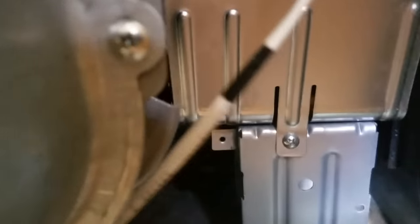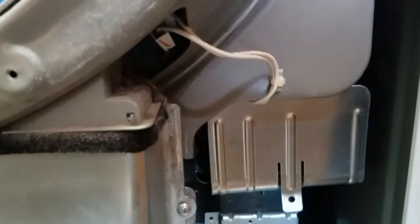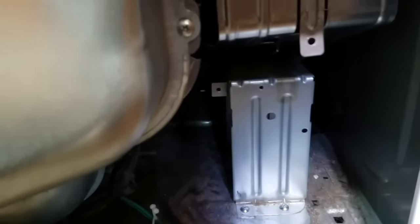And now this is what we're after — this guy right here. The heating element is right inside. So we need to take this screw out — there's a screw right here and then there's a screw up inside here. That will allow it to come through because I can't get the angle I need to pull that thing through the front. I'd hate to take off the entire shell and go through the back because it's all one piece wrapped around the back, so we'll take those out.